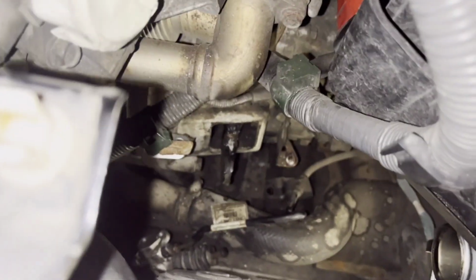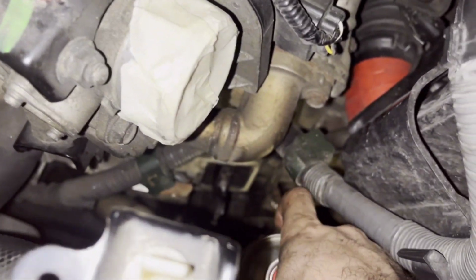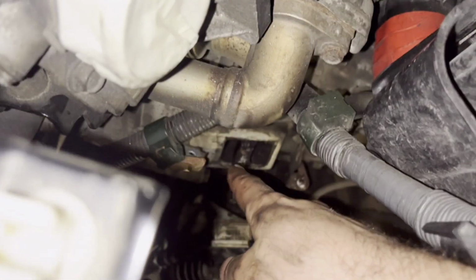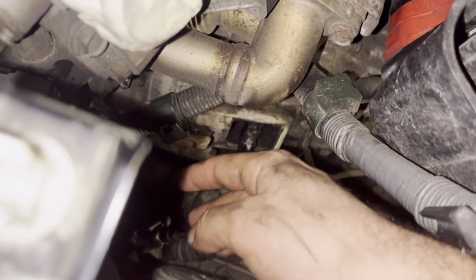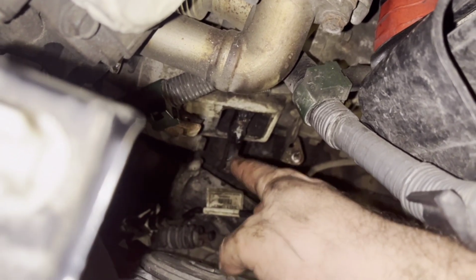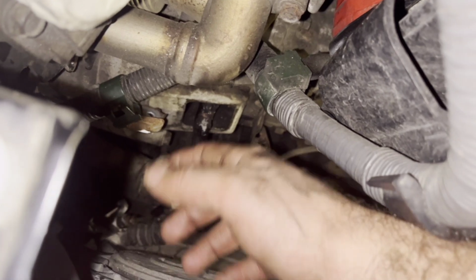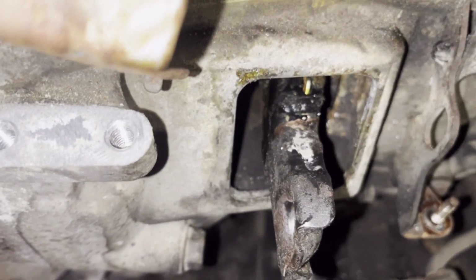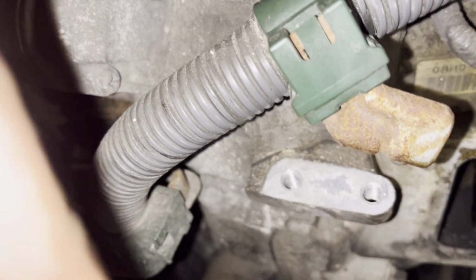Now, the cleaning was easy because I was just spraying from the outside to the inside, and there is a hole under the flywheel that dirt can go out from, or when they hold the flywheel, they hold it from there. So that hole is good because if you spray here, the dirt will go down through that hole. And be sure that the hole is open. In this car it's open, but be sure, if it's closed there will maybe be a rubber thing that is closing it, and it will be under the flywheel, like under the engine. Then you can see the flywheel from it.